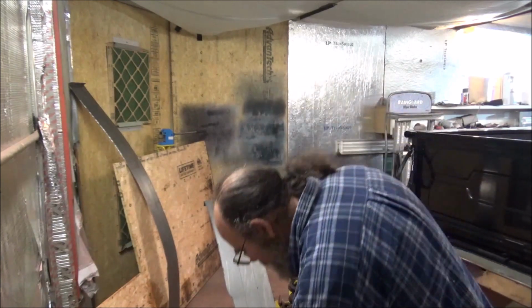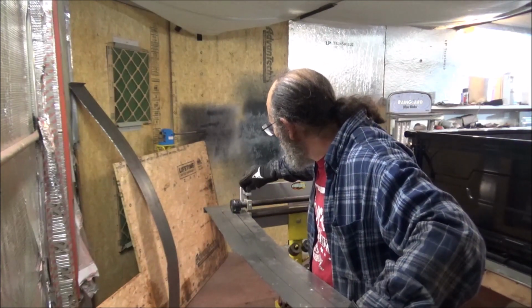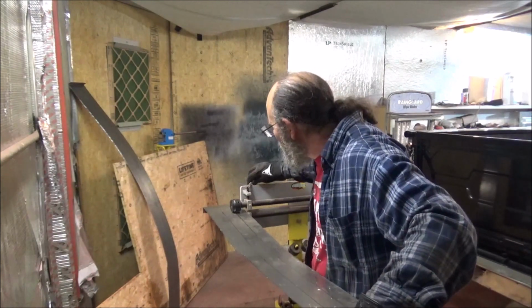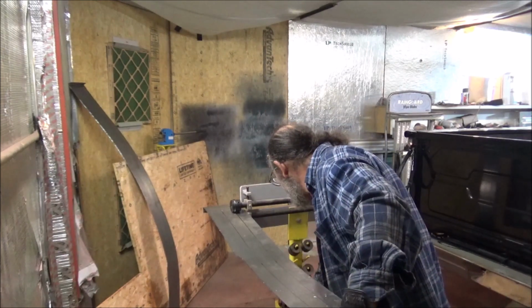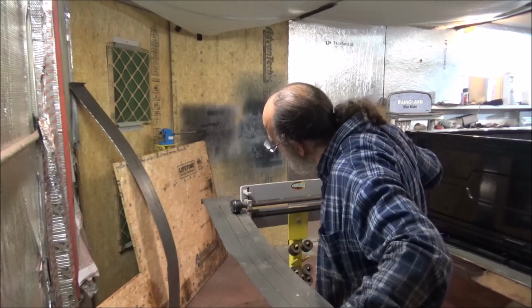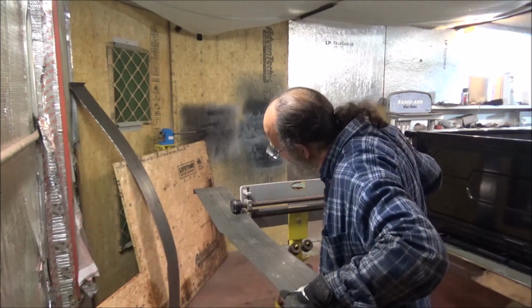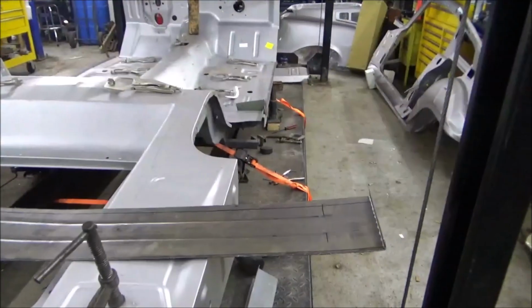I went ahead and drew me some straight lines on here where, if we're lucky, I might keep this thing straight. But I'll show y'all how this puts some rigidity into this piece of metal. This helps if you have somebody else to pull or push or catch the rest of it. And there we go. Yeah, the bead roller helped a lot with the rigidity and actually gives it a pretty good look.